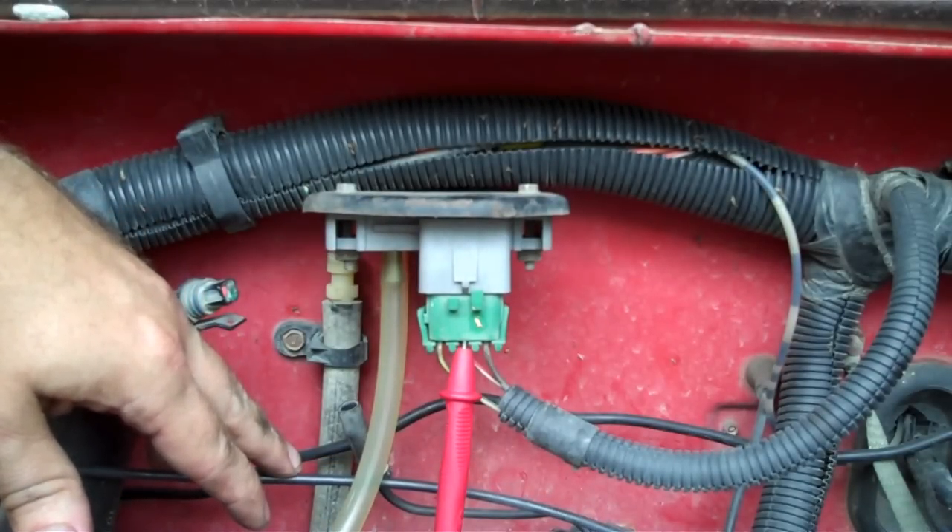So that's how you test that MAP sensor. Now, that wasn't that hard, was it? Just because it's got some wires and stuff like that, don't let it intimidate you. The beauty of these little YJs are, yes, they're fuel-injected, yes they've got sensors, yes they've got a little computer, but they're not that hard to diagnose. A MAP sensor has three wires, one vacuum line — three wires being five-volt in, ground, and five-volt reference. Reference meaning it's referencing how much vacuum signal is being applied to it, and it's going to vary the voltage sending it to the ECU. Not rocket science.